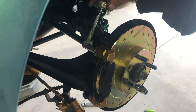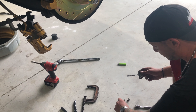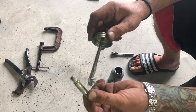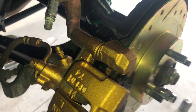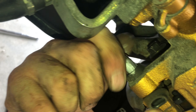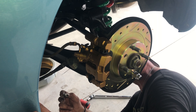Put a little bit of anti-seize or some type of lubricant on the pin, and also on the lower pin with the 10mm head that you took off, just so the caliper can slide nice and free. Got it all greased up, slides back on and then over the pads. You just line the bottom one up, stick it in, and put the caps back on and you're good to go.